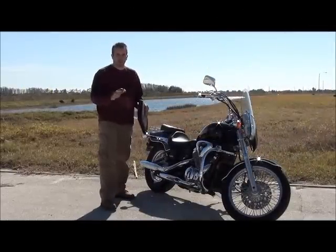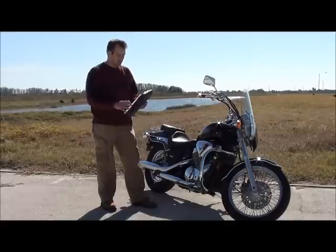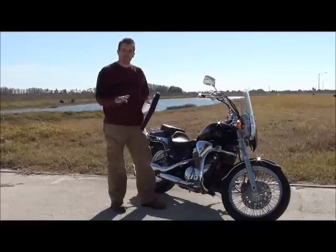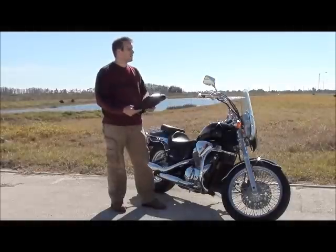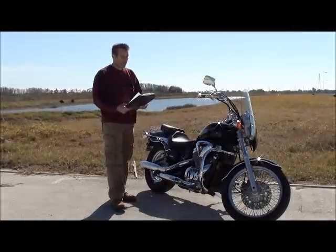Alright, now once you've already talked to the seller about the questions, everything looks good and you're ready to make the appointment to come see him, you're ready for the bike inspection. Now, a few things before you do a bike inspection. Never inspect a bike in a garage. Never inspect a bike when there's wet weather or when the weather's a little bit darker. It needs to be bright and sunny outside so you can see everything that you're going to be looking at.